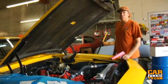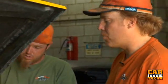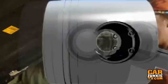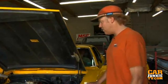It's idling at 1000 RPM. I've got 20 degrees initial timing in it because I put a really light spring in the MSD distributor, and we've got 35 degrees total — that's good for what we're doing. If I was driving this on the street a lot, I'd probably have less initial and a slower curve in it for 91 octane, but since all we're going to do is drag race for now, we're set to go. Chad's going to check the two-step rev limiter — the blue wire just needs 12 volts to activate, so we'll fire it up, activate it, and rev it up to our 3000 RPM setting to see if the soft touch action is working. Right at three grand — that's what we're going to use to launch the car.